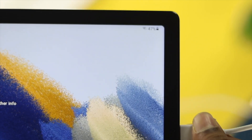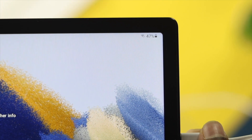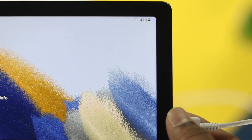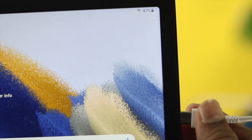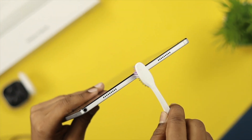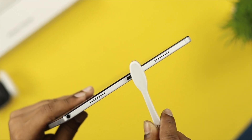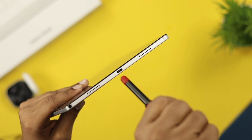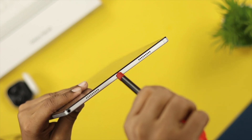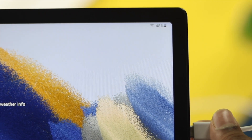Let's say you try to change your adapter and the cable, but the problem is still there and you cannot see that your charge is happening on your Tab. In that case, the next thing you have to do is a little workaround for your charging port. If there's a dust particle stuck inside your charging port, then this problem can happen. You can grab a brush or something like that and just start cleaning out your charging port. After that, check whether your problem is solved or not.